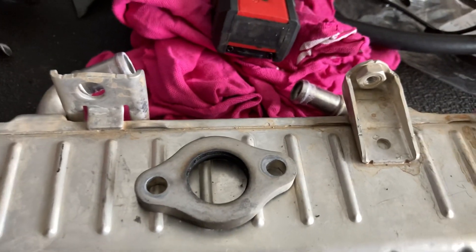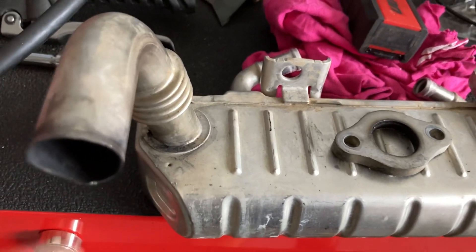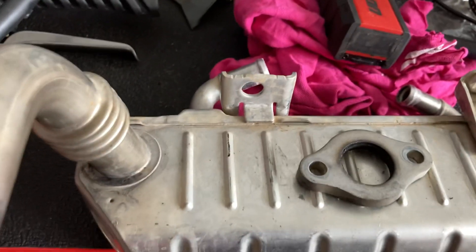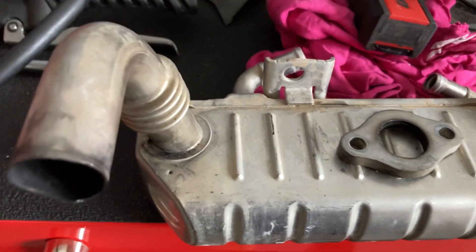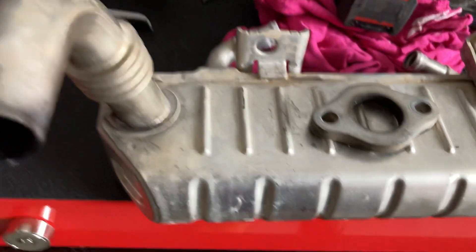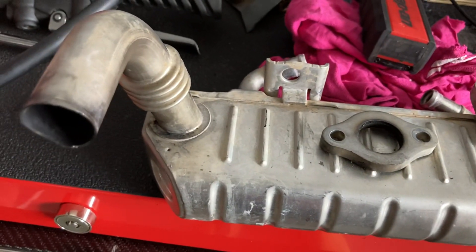Once you're all happy, I actually tighten those five bolts in many passes. I don't tighten up this one then tighten up that one. I bring them all in evenly, so the whole EGR cooler can move into the comfortable position it wants to be in between the five different mounting points. Do not forget this bolt, because that's what I believe is the reason why that's cracked and this is broken off. Thanks for watching, guys.